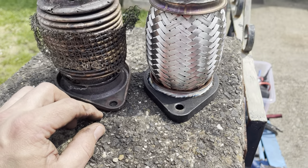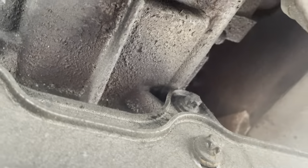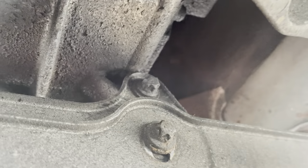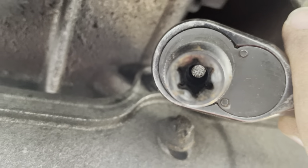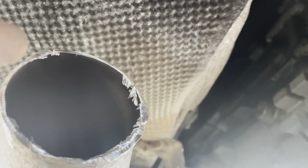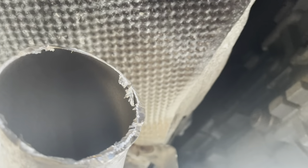I suspect what I'm going to have to do is send a grinding disc through one of them. To drop the exhaust down, I'm going to release these two bolts here. If you're not familiar with this head pattern, these are E sockets, and this particular one is an E10. The end of the socket is like a star shape, and they're pretty good because they tend not to round off even when they're quite rusty. So I've just sliced through the end of the old flange, because it steps out at this point, and I've cut this back to a round section of pipe that's the right diameter.